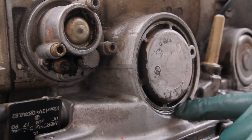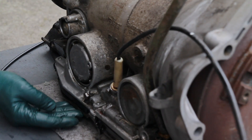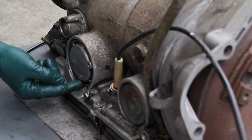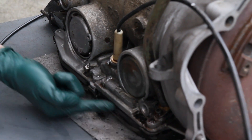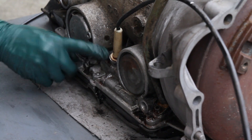Here you have another piston that can leak — not all that common — and then these two pistons here, which can also leak out their o-rings. What happens is you may think the leak is coming from the pan, but it's really dripping down from above, so you may change the pan gasket only to see the leak come back.